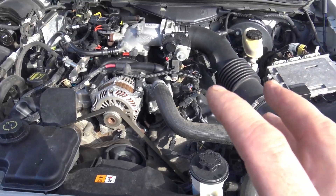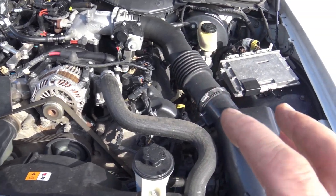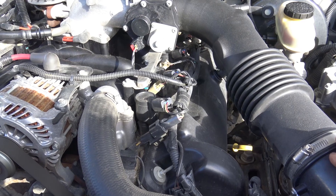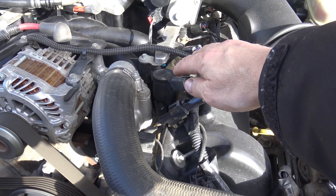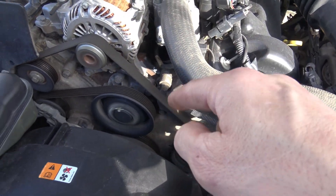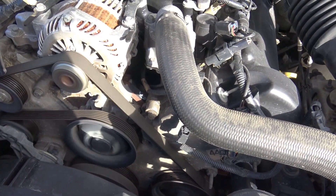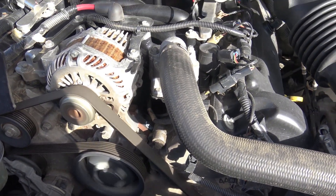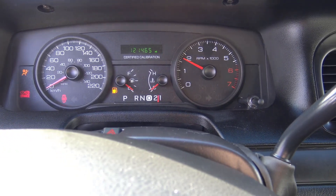The engine is running and you want to listen to it. This is how a Crown Vic engine should basically sound — it should be smooth, it shouldn't be vibrating. You should hear a ticking noise, but that's okay, that's the fuel injectors. What you don't want is any sound from down there where the crankshaft is, because you might have a spun bearing or something like that if you had a funky noise down there. There's nothing on this one — this one sounds good. Make sure she revs good, and she does.